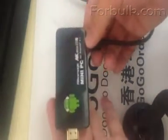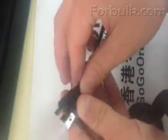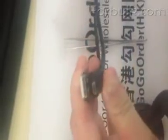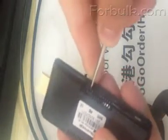To do the firmware upgrade on this box, a PC is necessary. And a USB to mini USB or micro USB port cable. And this tool — you use this tool to find the recovery button, the recovery hole. That's here. When you touch the hole, you can feel you press it.